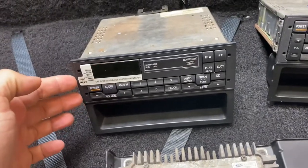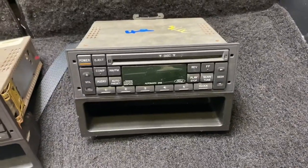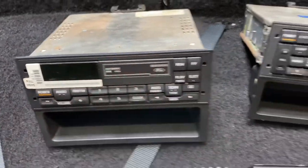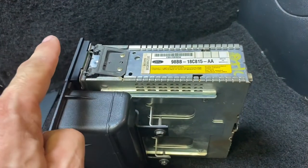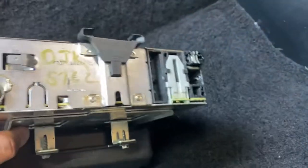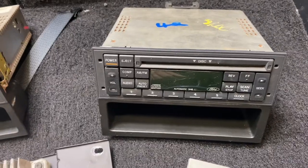Where you'll run into difficulty is the face plate — this head unit has a square edge, while many other cars had a rounded edge. If you try to put a rounded edge face plate with the cubby, it won't look right. The CD player came in many vehicles; the one unique to the Mustang has a clock button, while some Fords have a sixth preset instead. The bottom panel is removable — this is actually a 99 Contour CD player with the face plate swapped and the correct 93-style square face plate added. You can assemble these if you can find parts, though parts are getting hard to find.